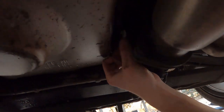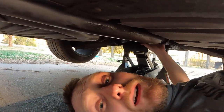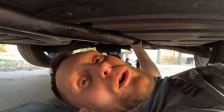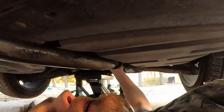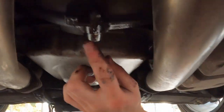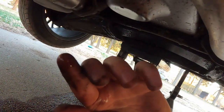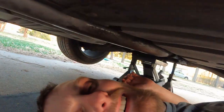That will be a job well done. That is how you check the transmission fluid on a 1997 to 2004 Chevy Corvette. I'm just tightening that bolt back in while inspecting my leak, which happens to be right there at the torque tube where the torque tube and the transmission meet. You can see that is a healthy, healthy amount of transmission fluid - that's where all our fluid went.